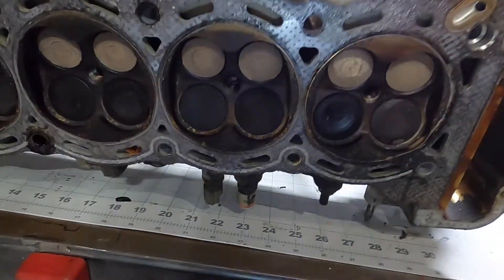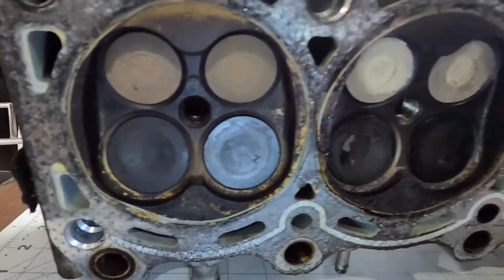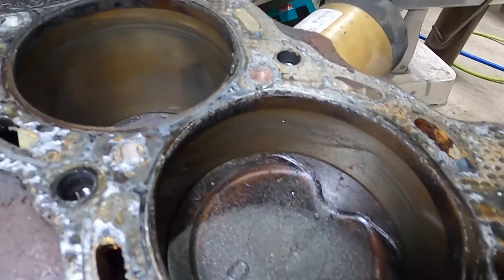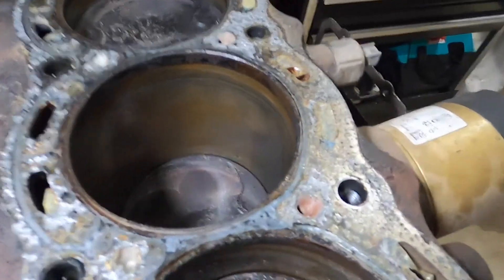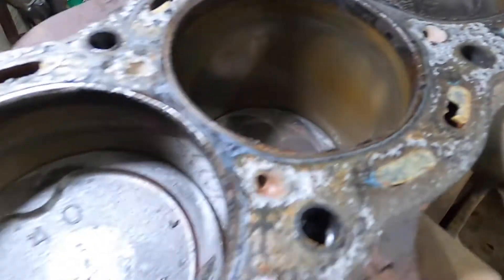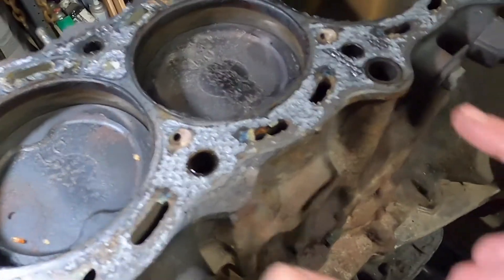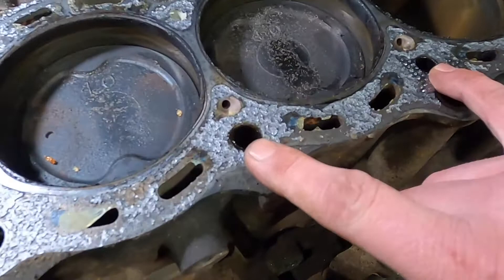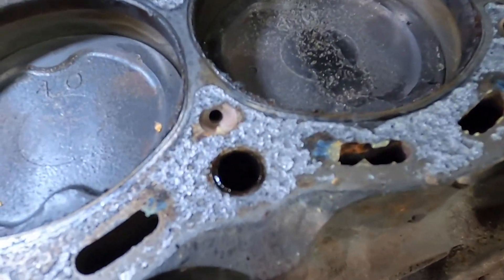Here's looking at the bottom of the cylinder head. They all look pretty uniform. The bores look actually really good — there's good hone marking and it's still got the cross-hatch. All six of them look pretty uniform, so pretty happy with everything so far. There are two holes where the cylinder head bolts were filled with oil — these two right here on cylinder number four. I'm not going to find out what's going on there until I get to the inside of the motor.